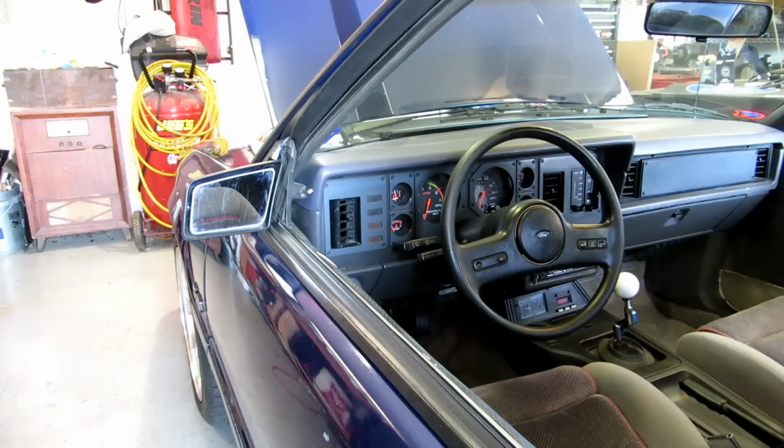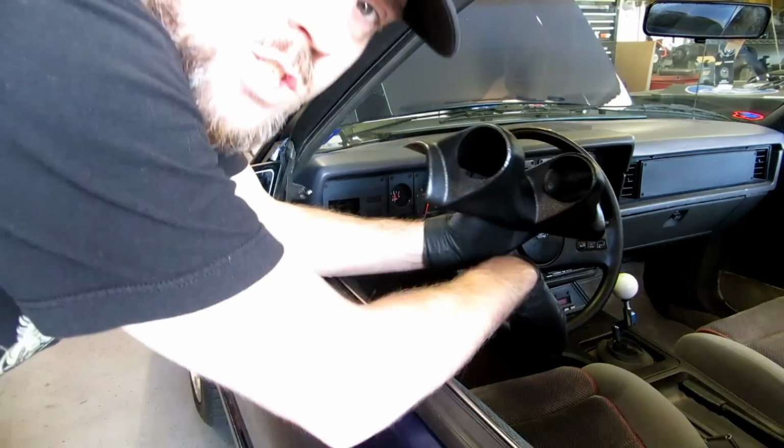And in case you've been living under a rock and you don't know what a wideband oxygen sensor is, these are extremely accurate. Your standard O2 sensors operate in a much lower voltage range and can only really read a small percentage of the oxygen coming out of your exhaust. These simply read how much oxygen and fuel mixture is going into your exhaust, and this tells me exactly what the engine is providing, how much fuel it's providing, and whether the engine's running lean or rich.